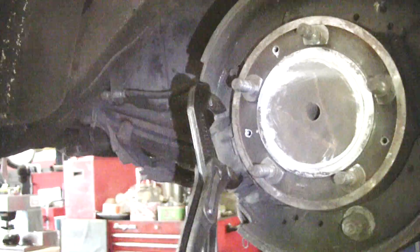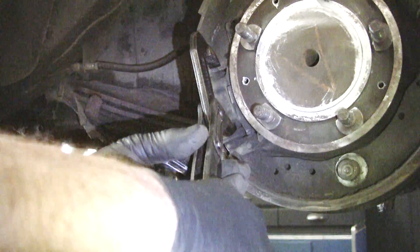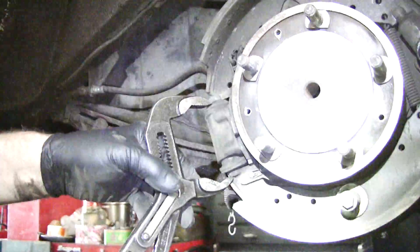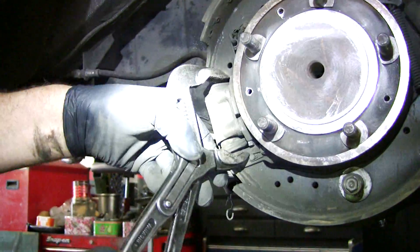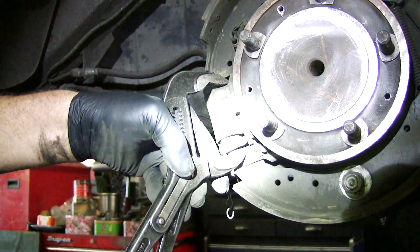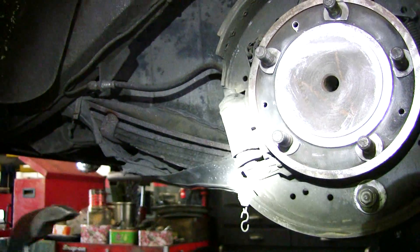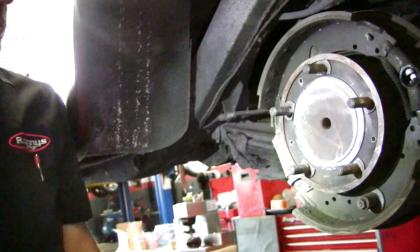What I'm going to do is try squeezing. That wheel cylinder is not frozen — see how it moves? And the bottom one — I'm going against the housing — that one moves too, so that's good news. And they're not wet. Wet's always bad.